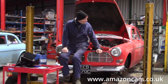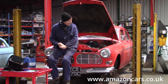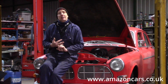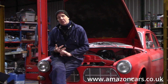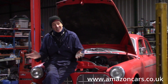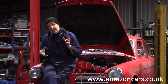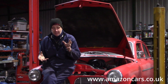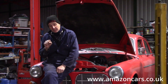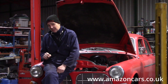This is George's car. I think this is going to be a really nice car — it seems to be a good one to start with. We're just sorting out the brakes now; front suspension is all done. Interestingly, one of the upper wishbone bushes was clearly cracked, but the bushes actually are all fairly recent. However, when I disconnected the ball joints — because we wanted to replace them — the upper and lower ball joints on the front suspension had issues.